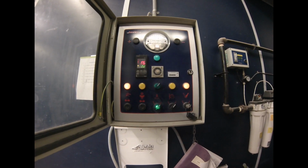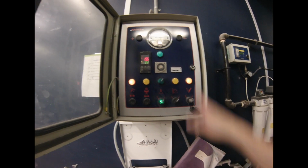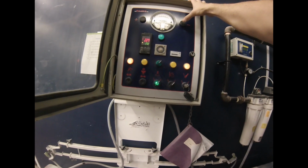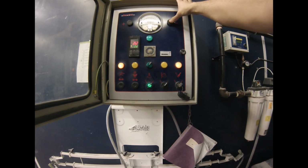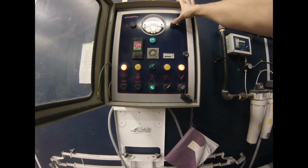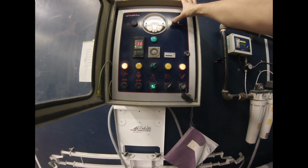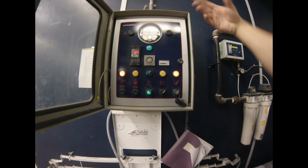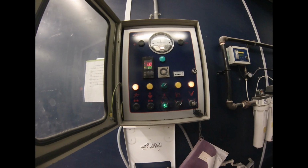As the furnace is turned on, it's now warming up the air going inside, right? So this usually changes too when the burner comes on, because it has a different flow now as the power is being put into the air makeup. It's pretty close to 0. You want it 0 or a little bit negative. You never want it positive, because then it's leaching out chemicals into the shop. Something like that is probably perfect.